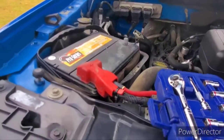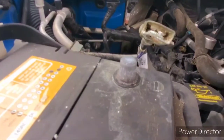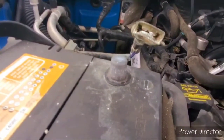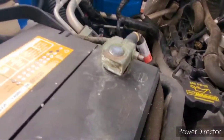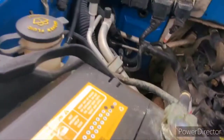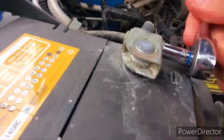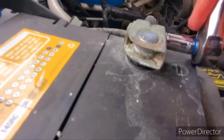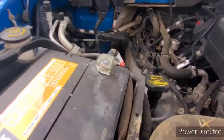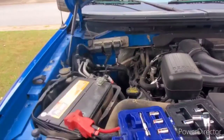My timer just went off. I didn't have one of those terminal cleaners — I'm confused about that because I've bought at least 25 of those and can't find a one. So while you're in there, you might as well clean up your terminal before reconnecting. On my 2010, this is an 8mm socket, and I took a knife and just scraped off some nastiness. Metal on metal is best, so I got that good and tight. Now turn your key over to accessory for about 10 seconds.